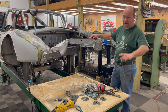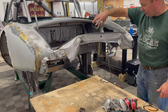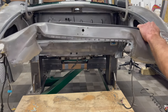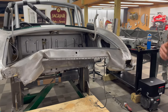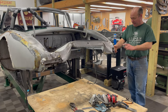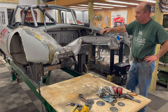I've got the initial big cut done. If you look down there on the floor, that's what's left of the boot floor — I just rough cut it out, and that took over an hour. Now it's going to take a lot more time to do the finer dissection, drilling out all these spot welds. I've still got to get this piece out without screwing it up, and I haven't started cutting into the rear wings yet. It's not always nice and pretty — sometimes you just got to get in there and go to town. I've got blood on my arm; I always say I'm going to wear long sleeves and then I forget. But we're getting there.